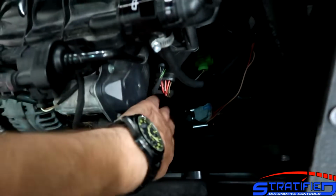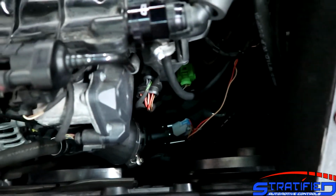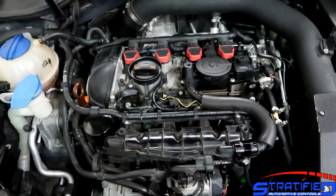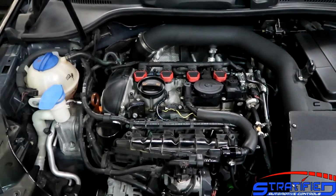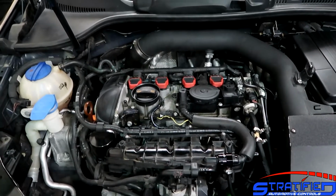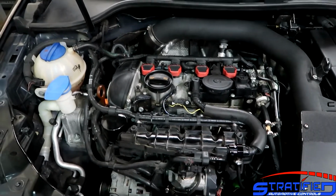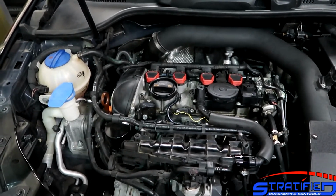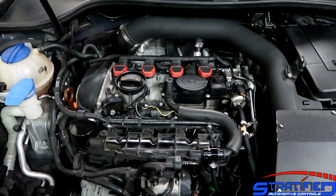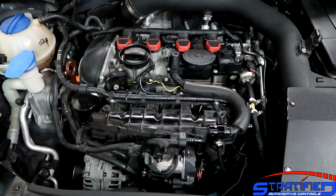The charge pipe that you see here that integrates our injector obviously comes with the kit, and it's very stealth. It fits the car very nicely, and it provides the fueling that this car really needs to push to those higher horsepower numbers, whether you're running ethanol blends, or bigger turbos with ethanol blends. I should also mention that the charge pipe comes with a water methanol bung. You can run this car with, let's say, pump gas and add water methanol injectors, so you have additional fuel from this additional injector, and you can also run water methanol injection on top.